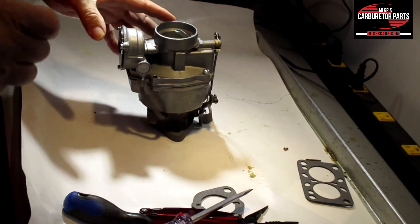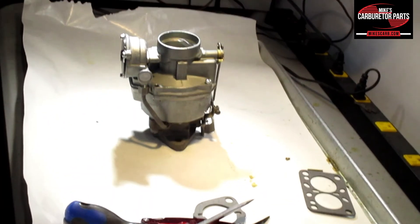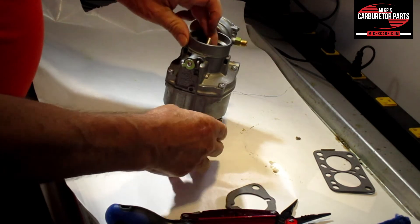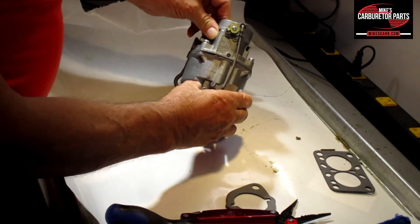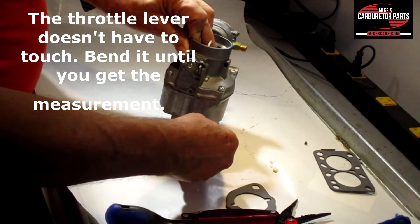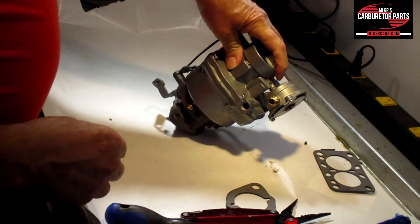Use the spec from the specification sheet — don't get trapped in a one-size-fits-all approach because it's not true; there are different measurements for different cars and engines. That's the choke rod gap. For the choke unloader adjustment, first open the throttle wide open, then hold the choke closed. The fast idle cam should touch — adjust it to touch the fast idle cam by bending it in or out, whichever it takes. You're measuring between the bottom of the choke valve and the wall of the carburetor. That's your choke unloader.